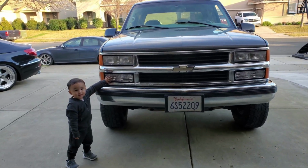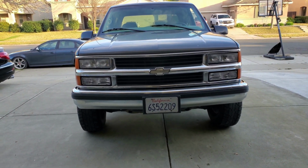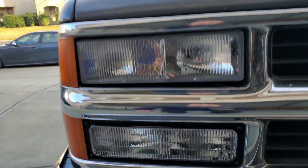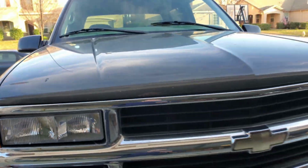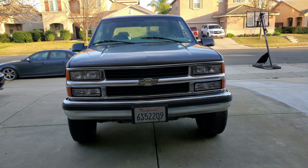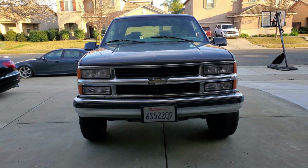Alright guys, so that concludes this video on the install of the new turn signal housings and LED bulbs for the turn signal housings and the corner lights. So basically all of this is 1, 2, 3, 4 Phillips screws, 1, 2, 3 bulbs. And it's that simple. So I bought the bulbs and the, oh yeah, I also forgot to mention the flasher relay. You also have to swap out the relay for that.